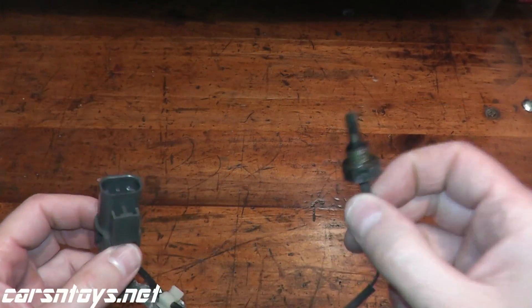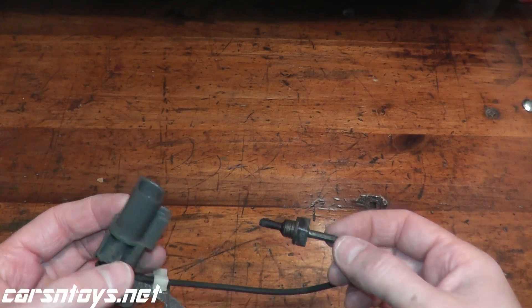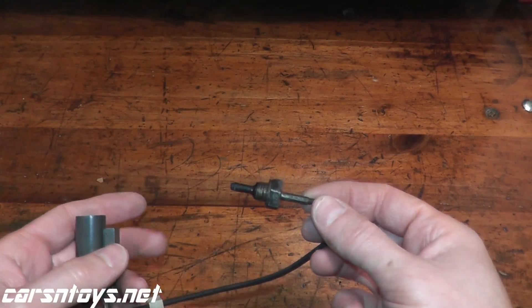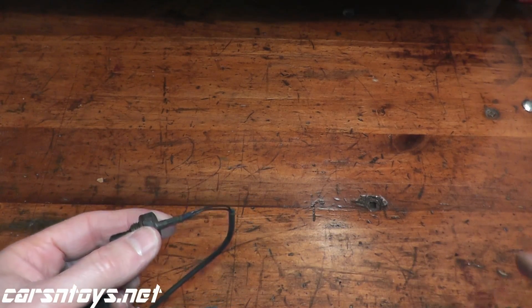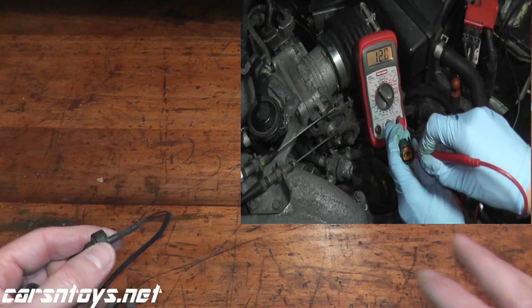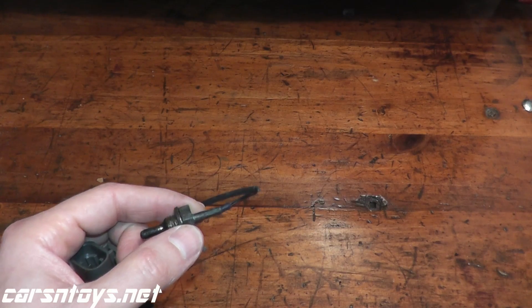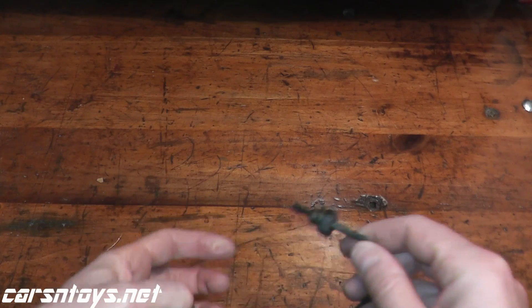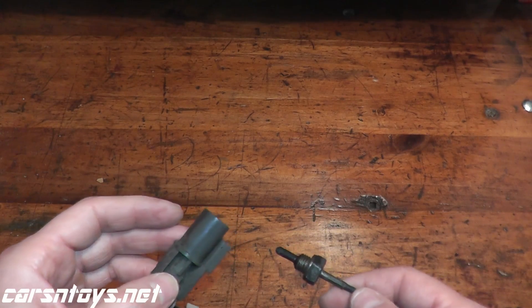These are the steps involved if you are receiving P1401. Check the harness connector — if all the connections are good, chances are it's just the sensor itself. If you did all these tests and still have P1401, there's a slight chance it could be the EGRC solenoid valve, which is a separate sensor. I have a video on that already — I'll include the link in the description box and as a card. But usually if you are getting this code, it's just a temperature sensor. Thanks for watching and we'll see you next time.